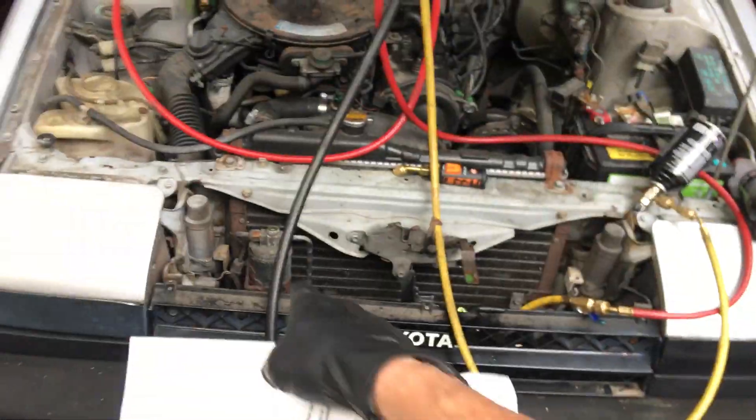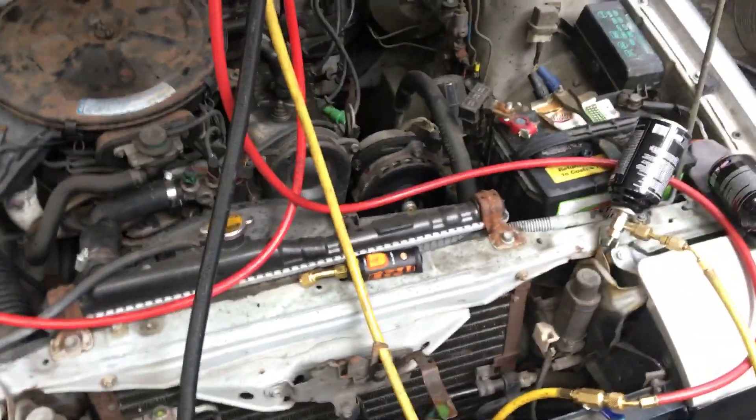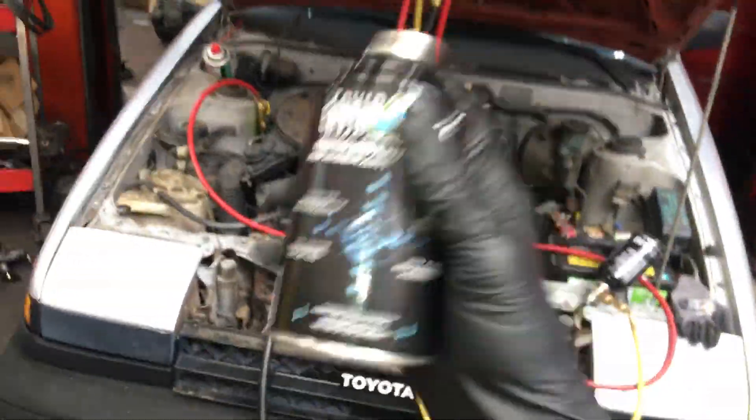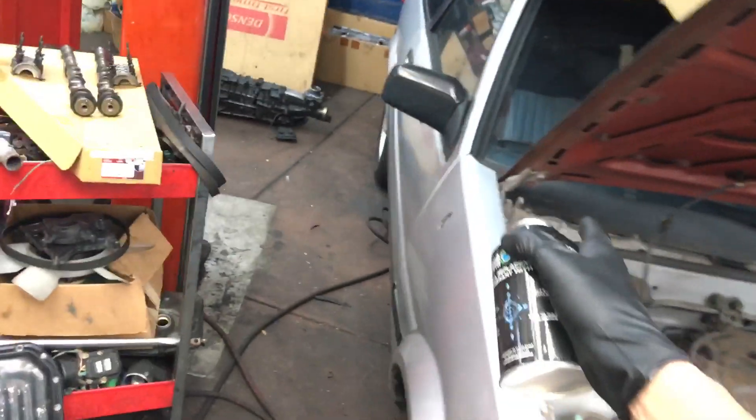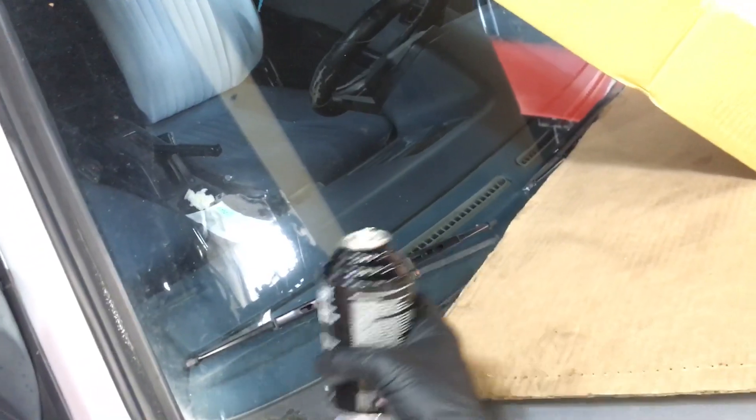So now he's going to be changing the dryer. Here's our pressure — coming out cold, so it works. I knew it would work. Hydrocarbon refrigerants are an excellent refrigerant, but would you trust a flammable, explosive hydrocarbon refrigerant inside a car, in an evaporator that is from 1984 — an old evaporator that could be corroded, cracked, or will crack soon after you put it into use?